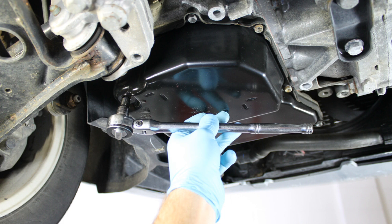Once the proper transmission fluid level has been attained, turn the engine off and exit the Rostec diagnostic software and disconnect the OBD2 port. If no fluid drips from the fill port, proper level has not been achieved. Reinstall the 5mm Allen drain plug, turn off the engine, and allow the transmission to cool below 30 Celsius and repeat the transmission fluid level process per the previous recommendations.